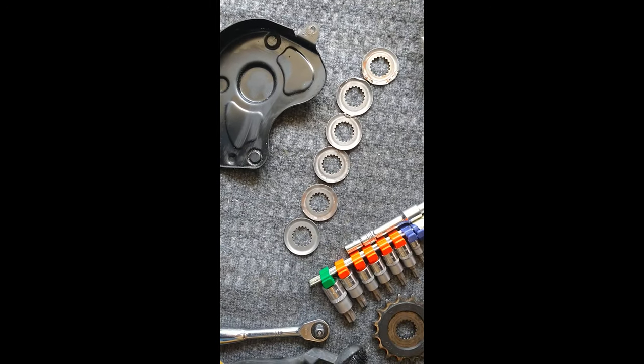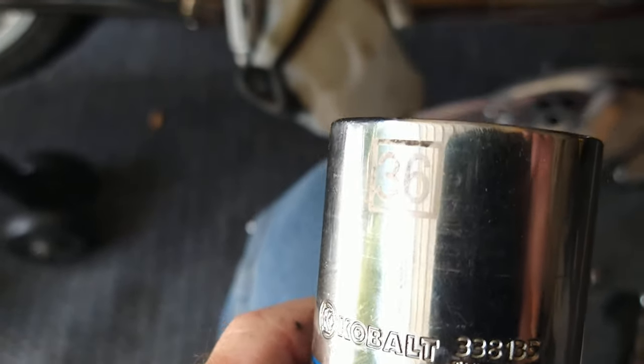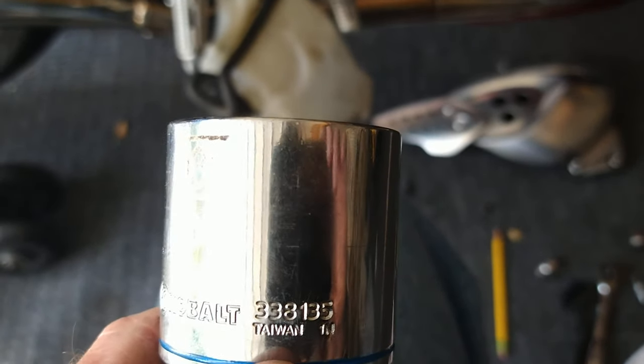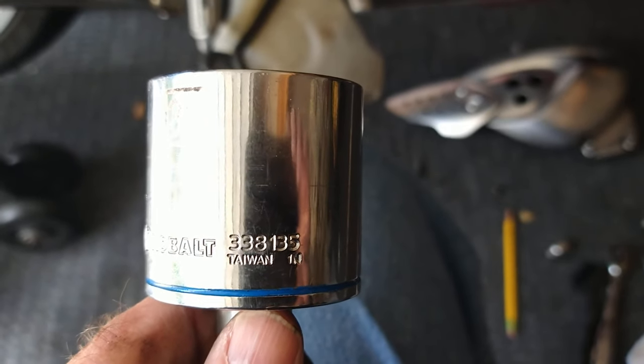Most of the time you can use those over more than once. To straighten the tabs, basically use a chisel and a hammer. Now with the chain on there I can go ahead and break that nut loose with the impact gun. You'll need a 36mm socket to break this loose. I keep mine torqued to a little over 100 foot-pounds — the spec actually calls for more than that, but I've never done mine more than that.